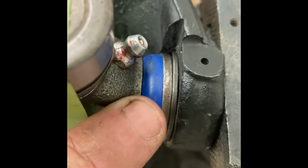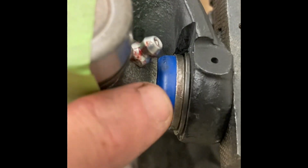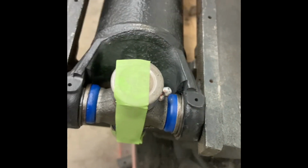because it was, trying to get focused, it was tight even getting the keeper in there, and that's the small one. So on the rear end, where it goes into the pinion, it only had room for the small ones, and it's a different universal. It's the same universal. I had different manufacturers because I got a nice new one when I did the transmission. And when you're looking at those, some of the caps are a little taller. So I think that's why, I mean, overall the dimensions are the same, but it's where they cut the groove in the universal for the keeper to go. It was taller on one side, so it would let you put a thicker one in. Either way, you just got to watch what you're doing.